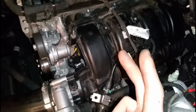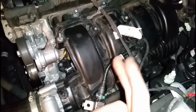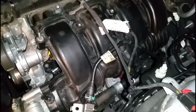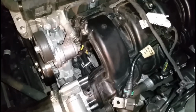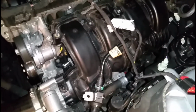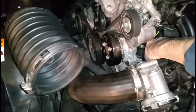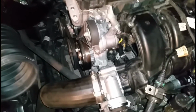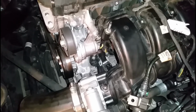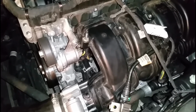There's not even going to be that long of a tube. It's probably going to be about 6, maybe 7 inches long with the connector connected to them. Take it off, cut the connectors at a point, get the fittings, put this tube through it. That way you can just snap them right back in again. Me, on the other hand, I have to do it and trust that I'm not gonna have any bends or anything in my tubing. So this is gonna be a project and a half because I have to make sure there is no bends in the tubing. Remember, vacuum, guys. It is a vacuum line.